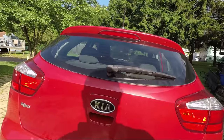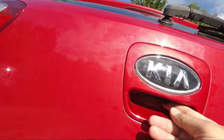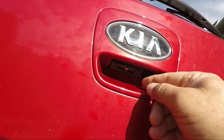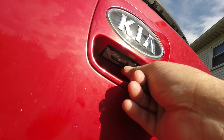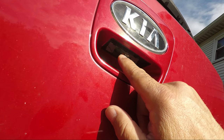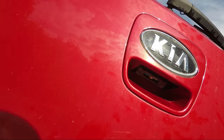If you look up in here you can see the latch. It's deteriorated to the point where there's no rubber covering the switch anymore — it might have gotten water in and shorted out, but we're gonna have to take that apart and replace it.